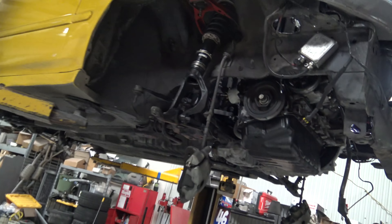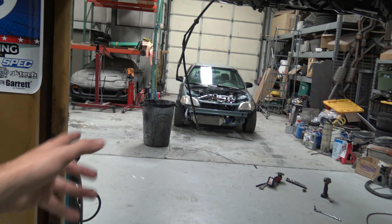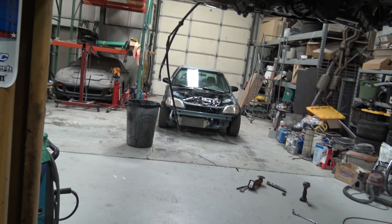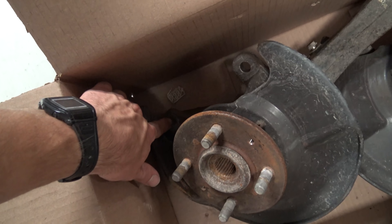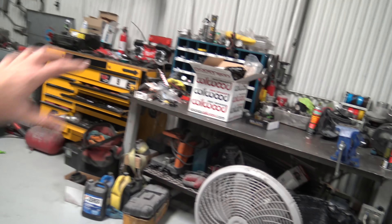In order to do this, this car is actually an LX or something like that — it didn't have the correct spindles. So the guy I bought the four-door sleeper from had another sedan sitting in his little parts yard. I went over there yesterday in like a hundred degree weather and pulled off the front spindles. These are EX spindles, and where the caliper bolts on is a little bit different — basically you need them in order to run this Wilwood setup on the front so it actually bolts on. The other thing I'm going to go ahead and do is install the axles. I got the half shaft installed here yesterday, just needed to tighten the bolts on there.